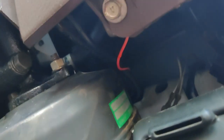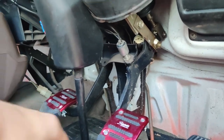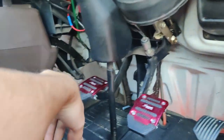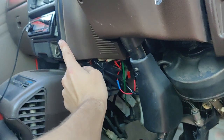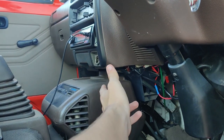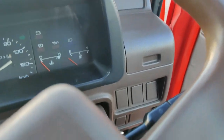I wired the speakers in myself. It's your brake system right here — no power steering. Don't really need it; it's kind of useless in these trucks. You've got your brake light sensor and everything's tucked together nicely. There's quite a bit of space back there. I've got my fuse tap for my head unit because these factory units only come with an AM radio, and it's only on switched ignition — there's no memory power wire. I'm going to wire in more speakers in the future, so I'll have four 4-inch speakers total.